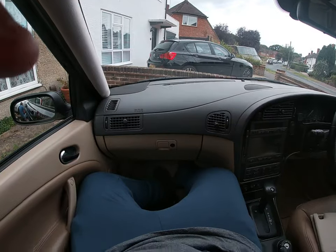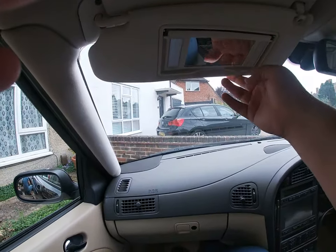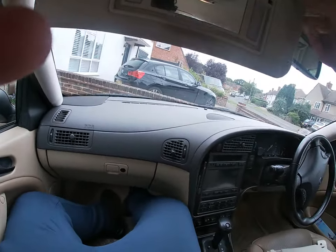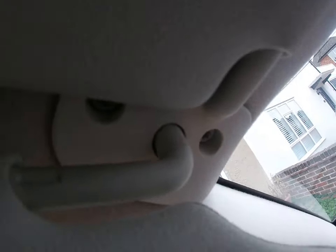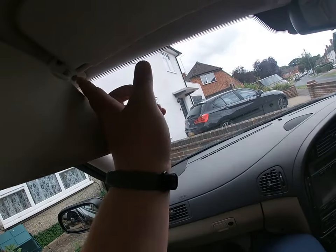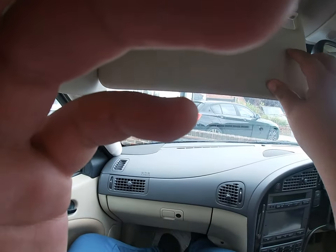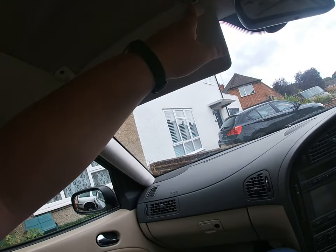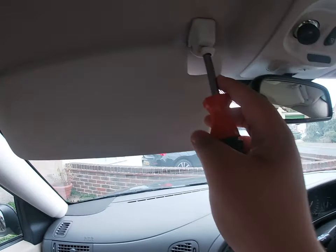Right guys, I'm in the car. I need to get the sun visor - there are some screws that hold it. I'll just unclip it from here to loosen that, which gives me access to these two screws. I need to find out what bolt it takes, so I'm going to pause. Right, I also need to remove that piece to get this off.